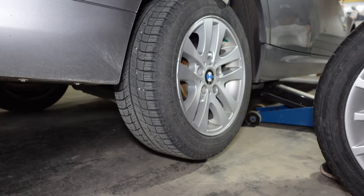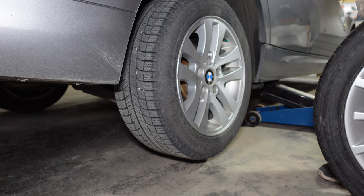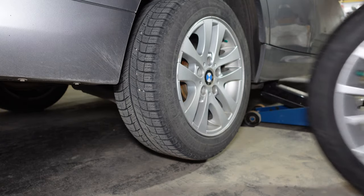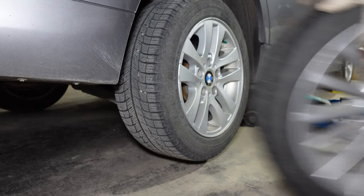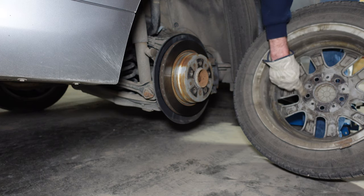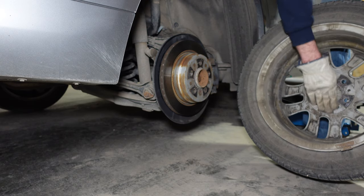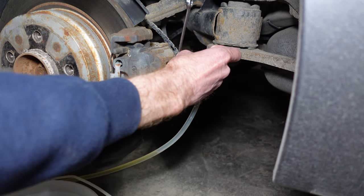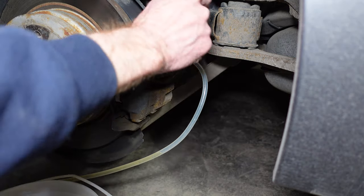These can be a little hard to get off sometimes, as the rims will bond to the steel rotor behind them. We'll just give them a bit of a love tap to bounce them off. When putting back on, we'll put a touch of anti-seize on there — that makes this process of pulling them off a little bit easier. We have our hose from when we sucked out the reservoir attached to our bleed nipple going into a bucket, and a 9mm wrench on the bleed screw.